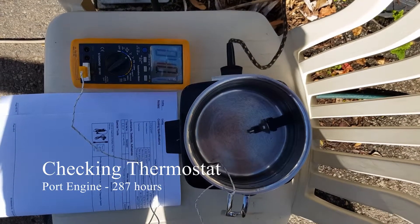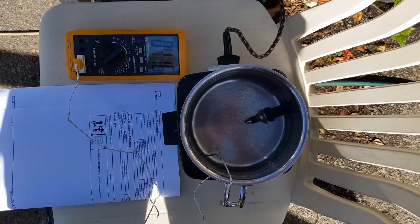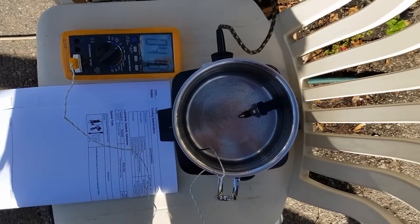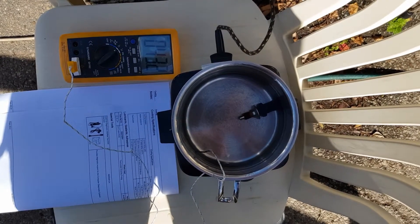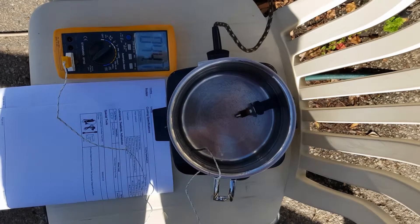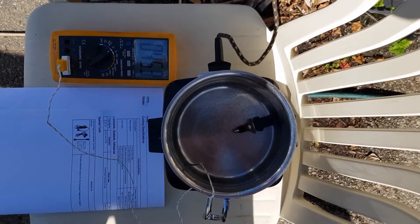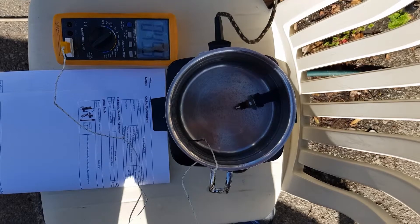We're at 40, six degrees off. It says 46.1 to 51.7 is when it should start opening. I haven't noticed any movement yet - we're at 42, which is okay because we're not in range. Something could start to happen after we get past 46. We're at 43 at the moment. We're at 45 now - maybe it would be more obvious. I don't know how quickly it will move.